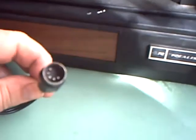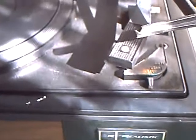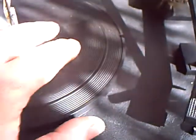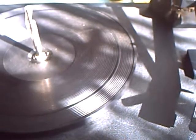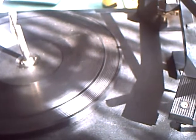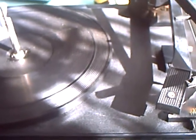As supplied, it came with the usual RCA lead, but I fitted the 5-pin DIN lead on it, and it was dead easy to do, because these BSR decks — a lot of them have an RCA plug underneath, left and right, underneath the turntable itself. Literally all we had to do was unplug the lead that was there and plug in the new lead with the DIN plug. It was as simple as that. It's nice when they're like that.